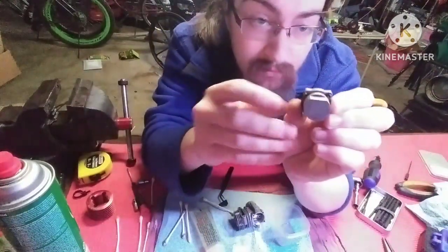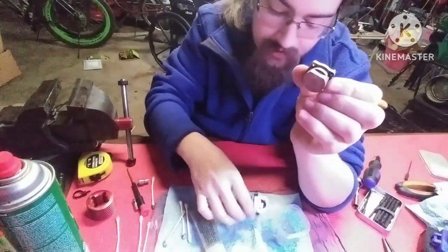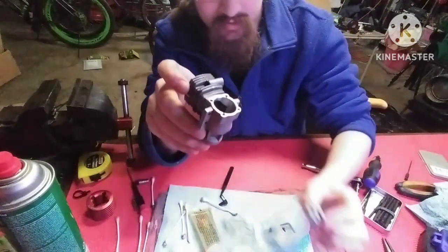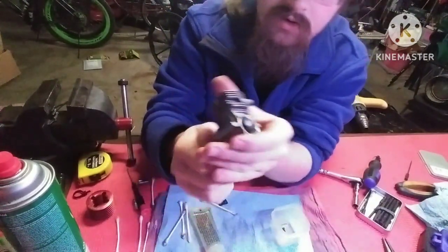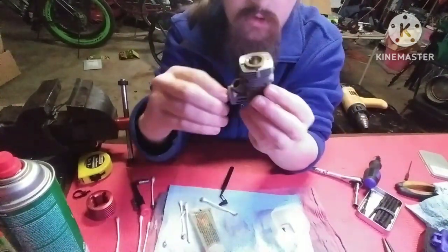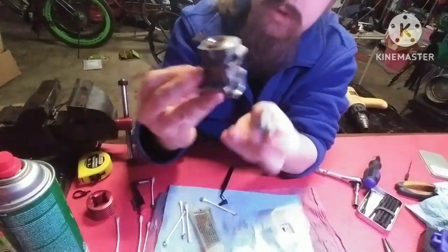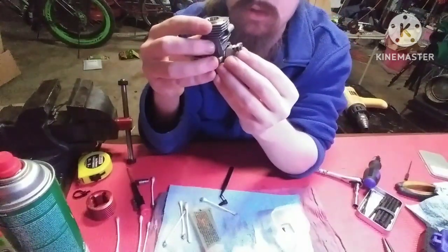Now, when you look at your back plate, you can see there's like a cutout. That's the top side. And that top side, that cutout, lines up so your piston, the way this is designed, that piston skirt cutout comes down so your piston skirt doesn't hit the back plate. That's why that's cut there that way, and it's also for your ports and opening all that. So you want to make sure this is put this way. You also want to bring your piston up to the top, just in case when you're putting this together.